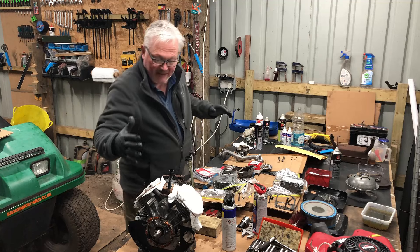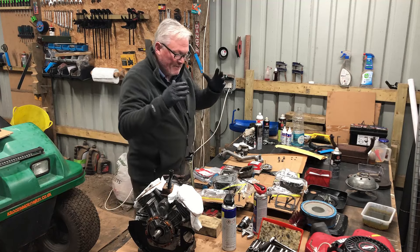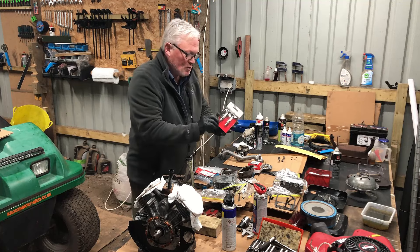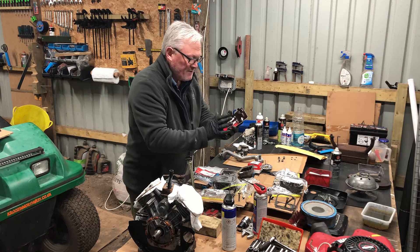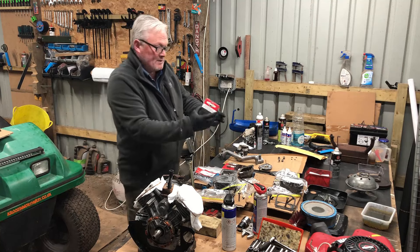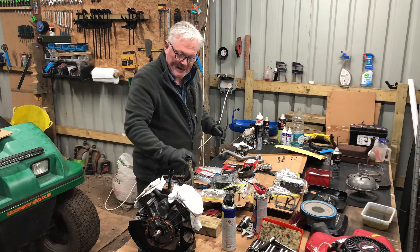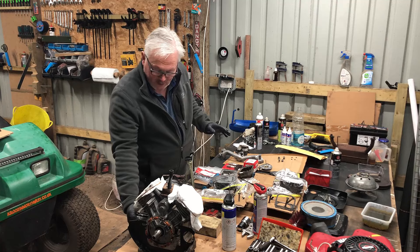So I've got to start putting this back together, but I can't run it up today because the flywheel won't be fixed today - I've got to let the JB Weld set overnight. I've got two brand new spark plugs, which happen to be the same type as this engine. I've also put in a new oil filter, drained the old oil and put new oil in - the level's okay, and I did fill the oil filter with oil as well.